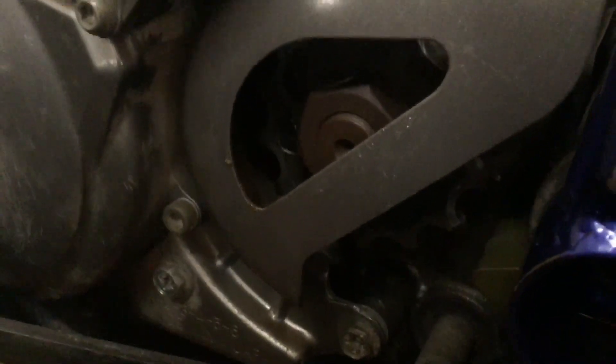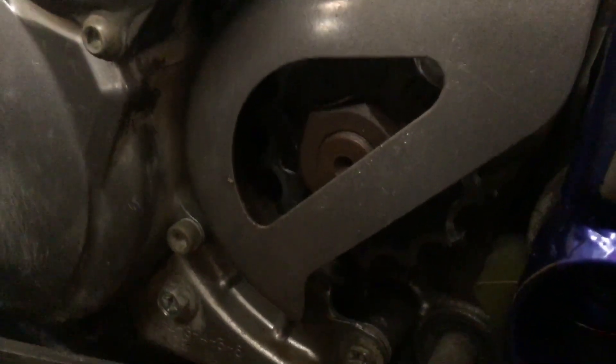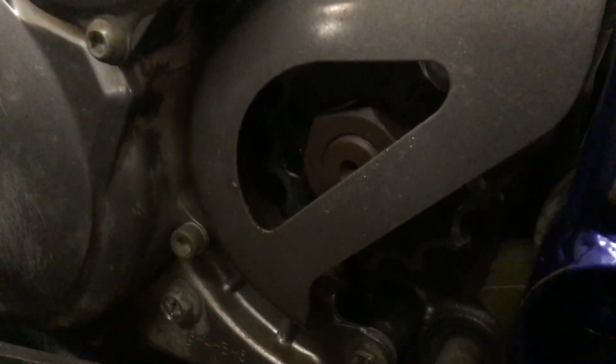I'm Mickey, this is the TTR. At the moment I'm just getting a rear shocker re-serviced. I was just showing him that nut — this is a 250, a lot more heavy-duty. There's the big nut on the counter shaft I was talking about. That's a much better idea because it doesn't allow the front sprocket to move at all on the splines — you've actually got it locked up. There's a lock tab on the top of that nut, so it locks and you can't move it.